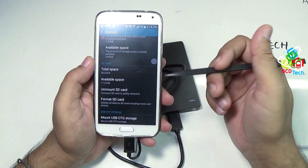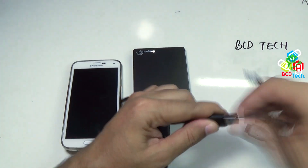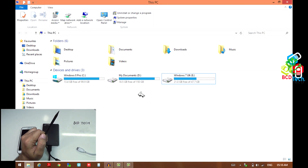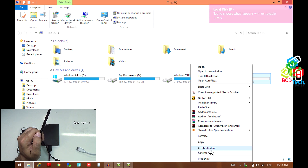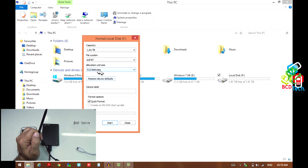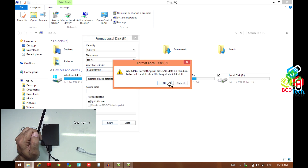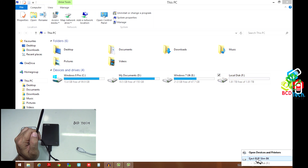To use this 2TB hard drive with your Android smartphone, you have to connect this hard drive to your PC and format it to the exFAT partition. It is very easy — just connect this hard drive to your PC, and once detected, right-click on the drive and go to Format. In the format dialog, choose the file system as exFAT with the default allocation size, then tap Start, confirm the warning, and tap OK. The format is now completed — close the dialog and take out this hard drive.